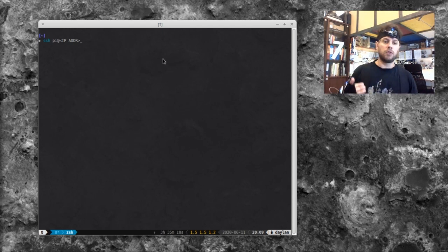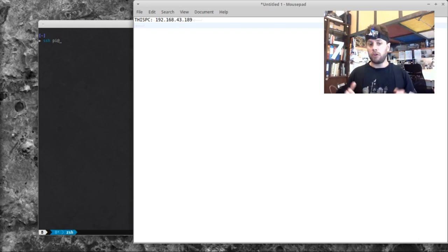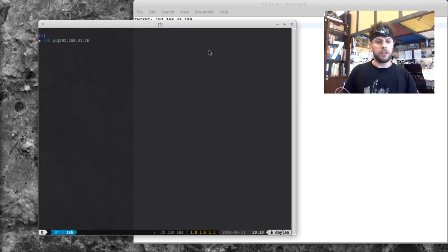I said each one of them because I will also need the IP address of this computer later, so I will get this information. Okay, so let me see, this PC has an IP address of 192.168.43.189. By the way, those are the local IP addresses of these devices. They are the IP addresses they are using in this local area network, not the IP addresses they use to connect to the internet. Okay, so for the Raspberry Pi, the address is 192.168.43.16. Let me copy this one